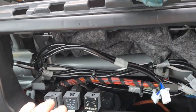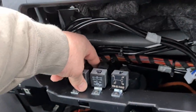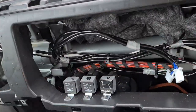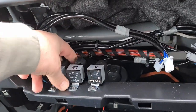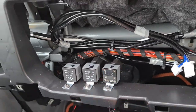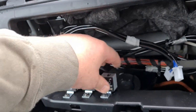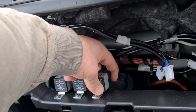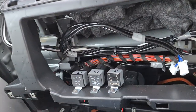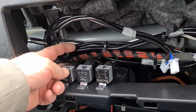Rather than building a big bracket, I'm going to mount the relays on here. In the end, if the relays fail I'm going to have to strip out this little bit here, but the chance of relays failing on spot lamps is few and far between. So for that little bit of inconvenience, I've mounted them here. I'm going to put a cable tie around them so they don't come loose — it's an old trick we learnt from rallying. Cable tie them in and they don't have a tendency to bounce out.